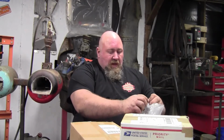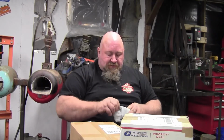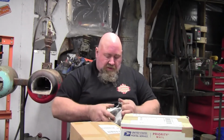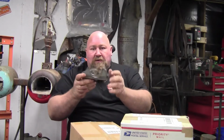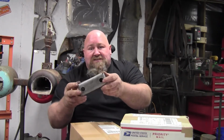This right here is the saddles. And I haven't even measured to see how thick the axle is on the Explorer axle, but these were only available in a 3-inch axle tube. This is probably what the axle tube is for the 63 to 72 Chevy. But these are the saddles that are going to have to be welded on the 8.8 when I get that far. As you can see, they're offset. One side is set towards the other, and they sit at an angle across the axle tube because the trailing arms go up to the middle of the truck. So that's those.